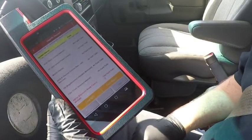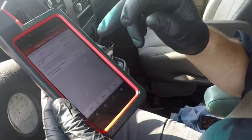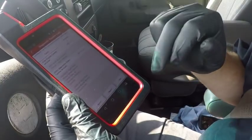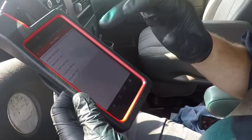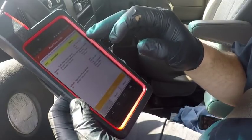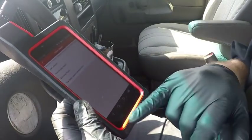It's done scanning. Let's go to the fault report — it'll make a report for us. We can expand each one: we've got a brake switch circuit high voltage — that's pretty common on a Chevy. And then right rear wheel speed sensor circuit open or shorted to battery, right rear wheel speed sensor circuit erratic. We've got C0050 with a 05 and 0F qualifier. Going into the EBCM, we can read codes — it gives us not run, failed, and passed history. Actuation test options include ABS motor, automated bleed, solenoid test, yaw rate sensor calibration — it's got all the relearns you'd need.